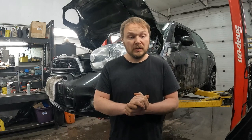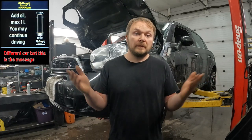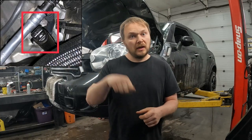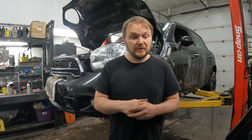This one here has the minimum oil level light on. You put the key in, you fire it up and it says: warning, low oil, top up, add a liter. This particular vehicle is old enough that it does have a dipstick. Some of the newer ones, they just have the tube but no actual stick in there and they rely solely on the oil level sensor.